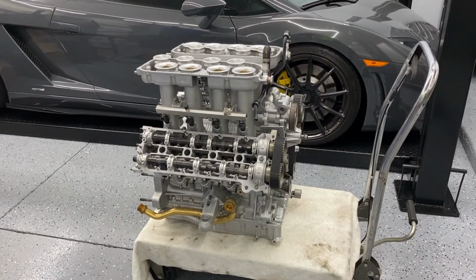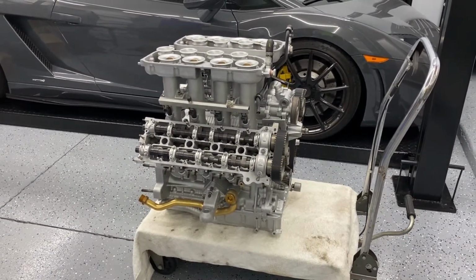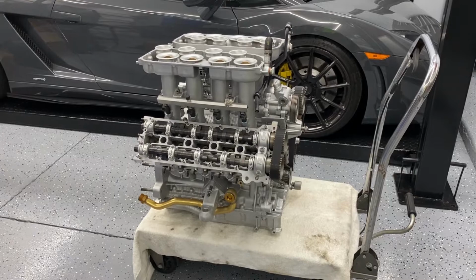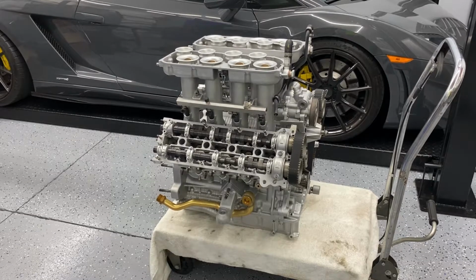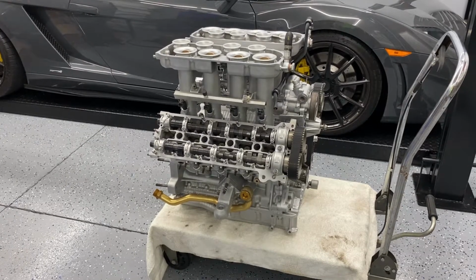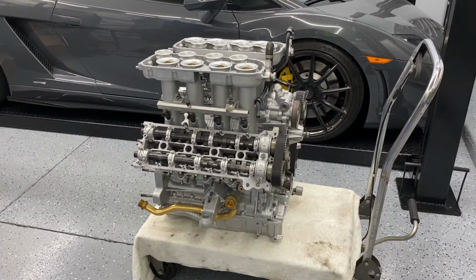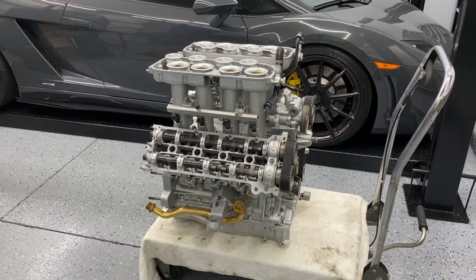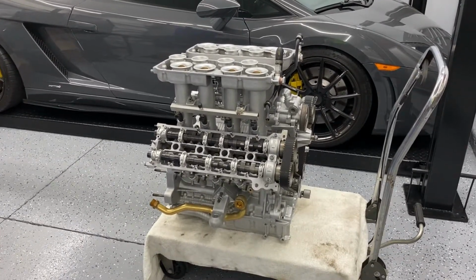Like I said, I'm constantly changing the water out because it's completely black, and it's not going to clean as best as it's capable of. And then I also have an issue with my compressor. I won't go into full detail on that; I'm going to make a video on the vapor honing machine and talk more about it later. But it just does not have the power to run this vapor honing machine. I think the minimum requirement is around 20 or so CFM, and mine is only putting out 15.8, so it's well below the minimum requirements.